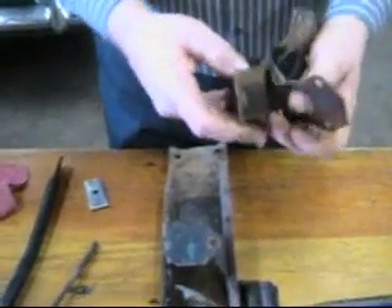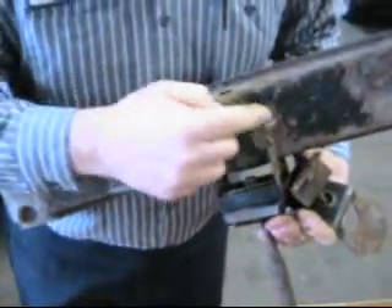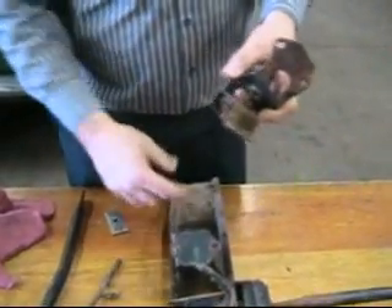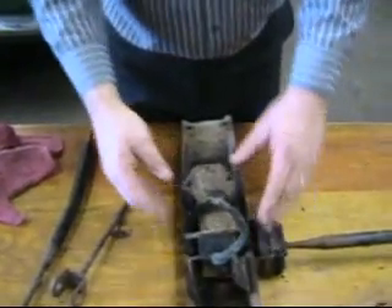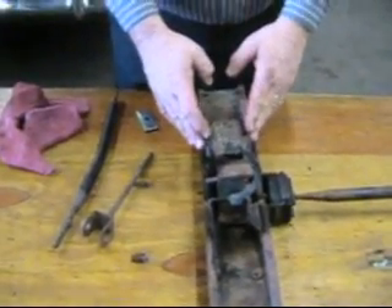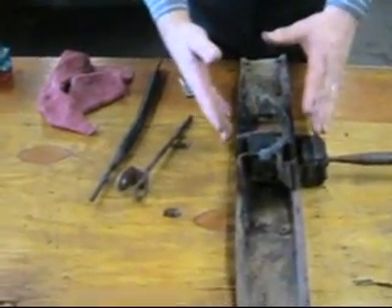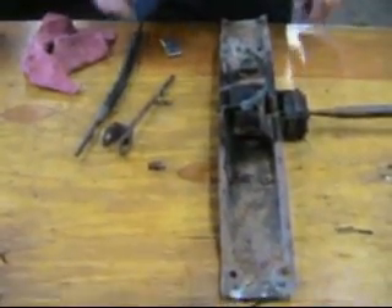I use some long bolts, and I also put this into the vise and squeeze it just a little bit. Because even though the holes are slotted on the bottom side of this crossmember — one of them is slotted, maybe slotted by hand — getting this thing started back in can be a real bugger. Squeeze it just a little bit, get your bolts started. Leave this piece all loose, then put in your coarse thread bolts, five-sixteenths eighteen. Always start the most difficult ones first. It always helps if you've chased the threads in the gearbox first, and sometimes it helps if you put a point on the bolts. Attach this to the gearbox first, then jack up the rear end of the gearbox, and go ahead and make your mounts with the larger bolts.